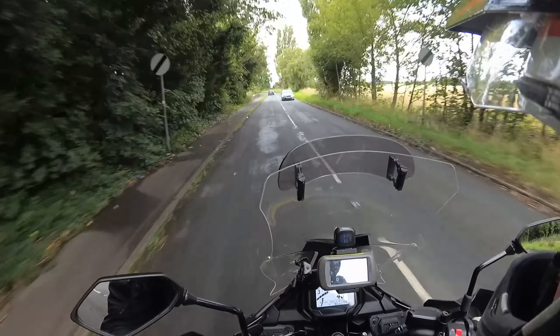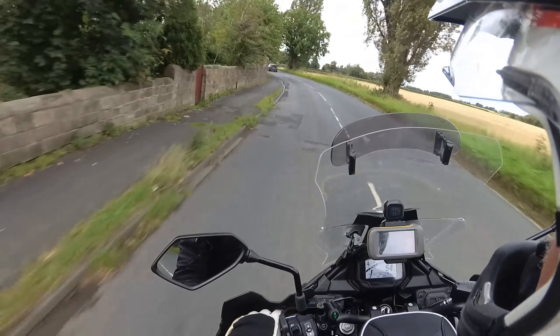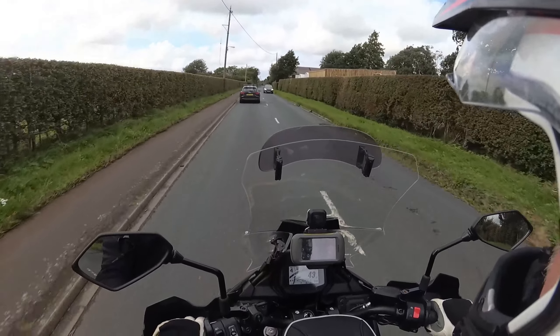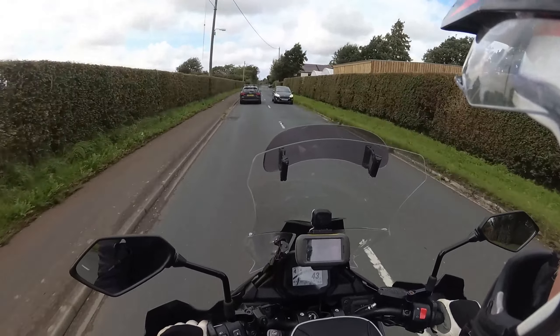Still staying with the 16-tooth front sprocket. I much prefer that long-term over the original gearing for the type of riding I'm doing. I'm not so bothered about fancy acceleration — I just enjoy the mid-range. Third and fourth gears are really, really pleasing when you're touring along. Fourth will go from 35 miles an hour to near enough 100. I just like the long-leggedness of it all.